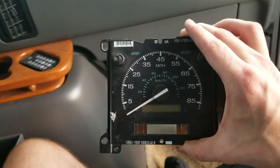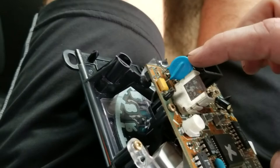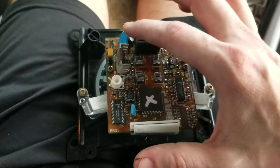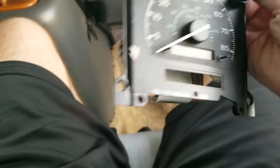Here's the original odometer — it has about 38,000 miles on it. Whenever we purchased it and started fixing it up, one of these capacitors went out. This one right here caused a speed feedback problem to the transmission, and the transmission would not shift out of second gear — it would go first, second, and stay in second. This is a pretty common problem, so we bought a rebuilt unit off eBay — there's a guy who rebuilds these speedometers. That's why the mileage is different. I can guarantee if you plugged this back in it would say 38,000 miles. We've put about 2,000 miles on it in the two-plus years we've had it.